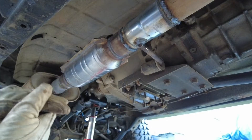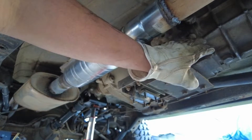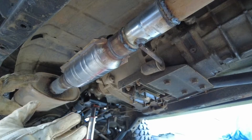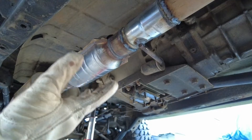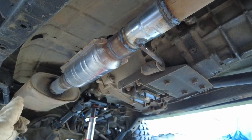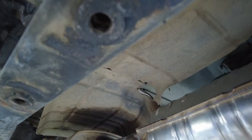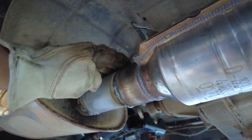Since I'm already down here, I'll go ahead and drain the gearbox oil and service the transfer case — I might do that in another video since the skid plate is already removed. Our O2 sensor is installed. One important tip: if you're replacing your cat or doing any exhaust work, the O2 sensor cabling goes through this hole in the sheet metal bolted to the bottom of the tub. Make sure your cable goes through that hole so it's suspended above the exhaust and won't melt on it.